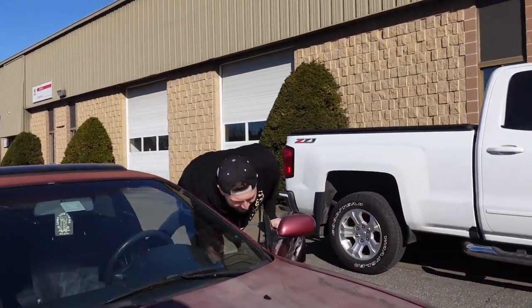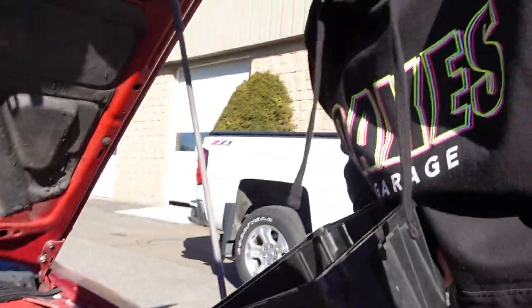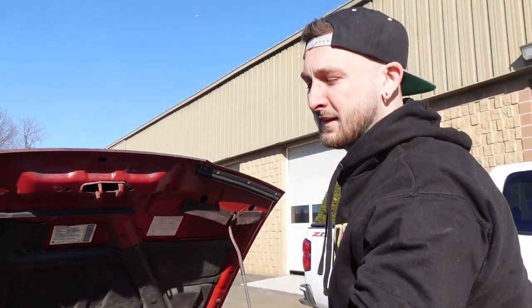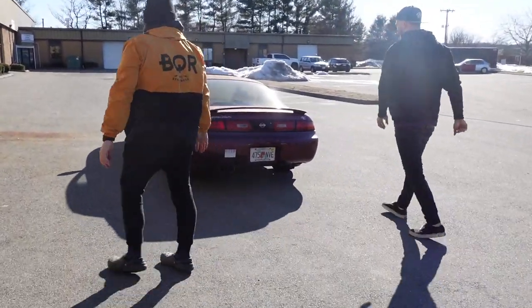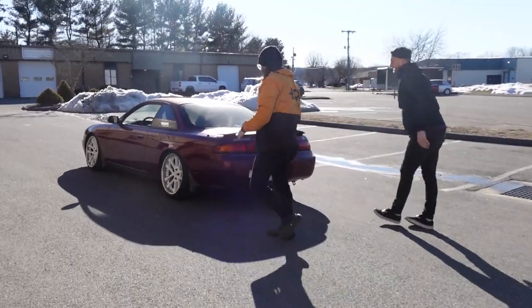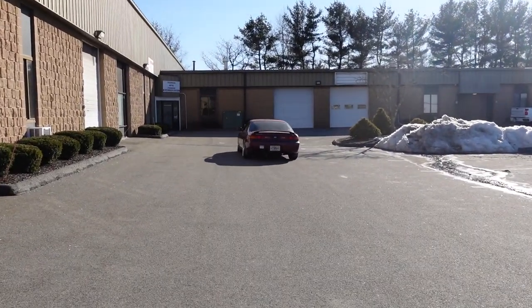It's definitely in limp mode right now. It's a little limpy. I'm gonna change the MAF real quick. Here, Donnie. Thank you. I hope it's this easy. It's never that easy. Might need that jump pack again. What's the key on? It wasn't on. Do it. Did it work? I don't think the MAF fixed it. Damn it.